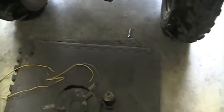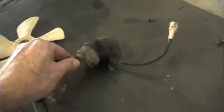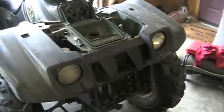So I've taken the fan out and there are some fan motors on eBay. I put electricity to it, going to a battery, and the fan wouldn't go around — it was stuck. I did get it freed up but it still turns very hard, so this little motor is burned out. I need to reuse this rack; I can get a new fan motor off eBay, and I hope that fixes the problem.